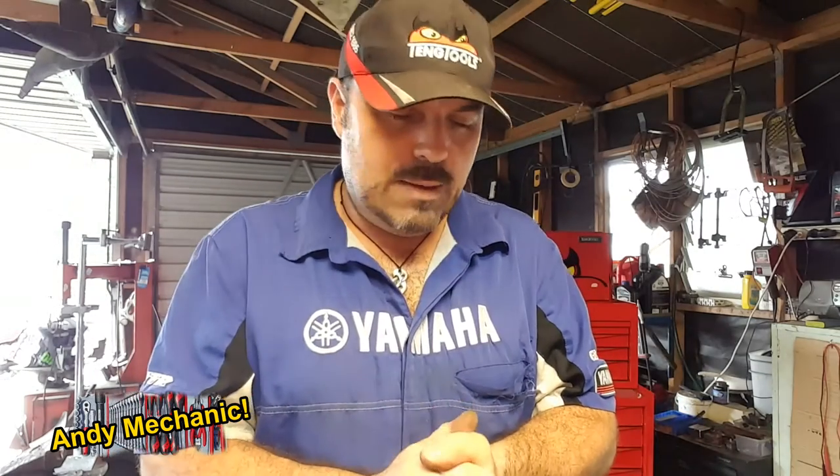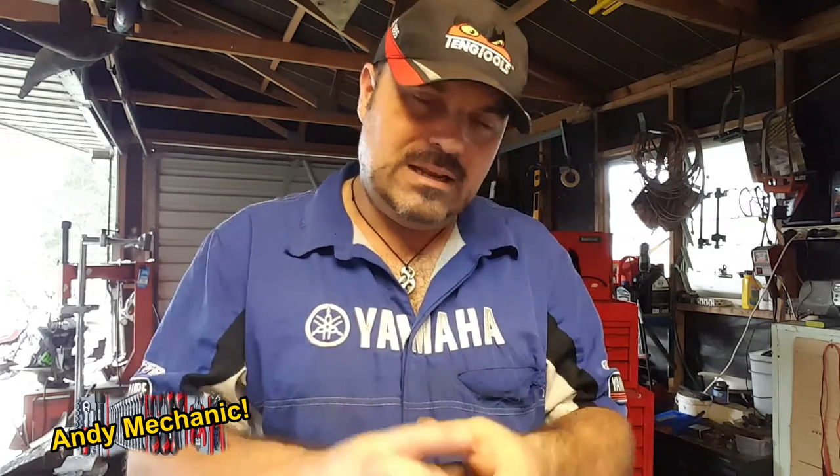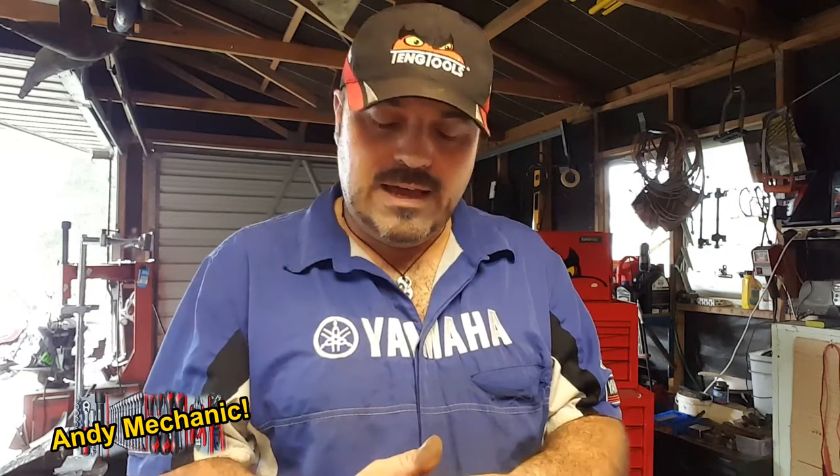There's loads of reasons why it can happen. And the oil from inside the shock has started to leak out and it leaves a stain down the outside. Now, it's not officially a warrant of fitness failure unless the shock actually isn't damping anymore, and that we do with the bounce test, or there's an excessive leak where there's literally oil running down the outside of the shock and dripping onto the workshop floor. That will be classed as an excessive leak and it'd be a fail. So visually, looking at the shock from the outside on this particular vehicle, it's not a fail.